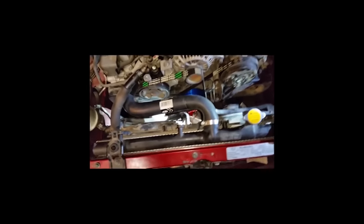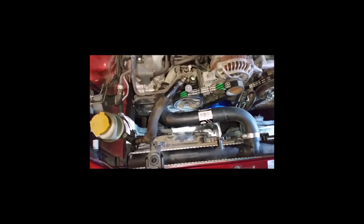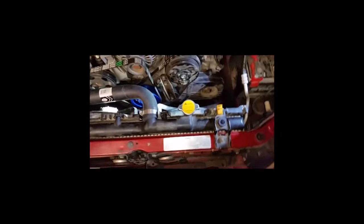Okay, well, let's see, pretty much all buttoned up, just need to put in some radiator fluid, mix that up, put it in there, bleed it off. Gotta add some power steering fluid, which is automatic transmission fluid actually, and top off the automatic transmission fluid. Had a little leak out when we were putting the power steering pump back in, also the cooler. Not power steering pump, but the automatic transmission coolant lines, getting them reconnected, and the cooler on the bottom of the radiator leaked some out, so probably lost maybe 2-3 ounces. Wasn't very much it looked like, so everything came back together pretty well.